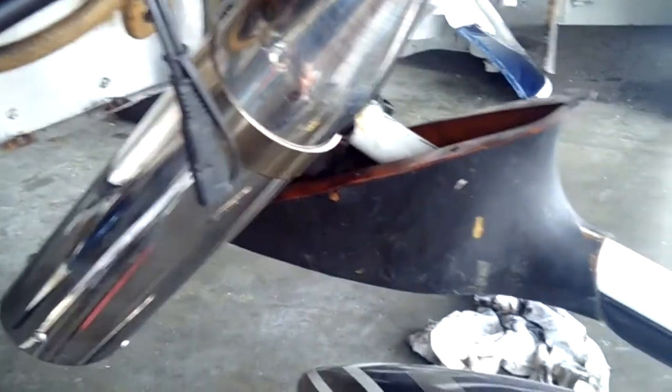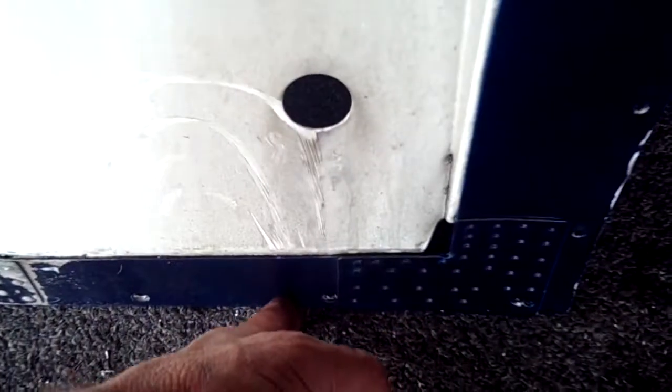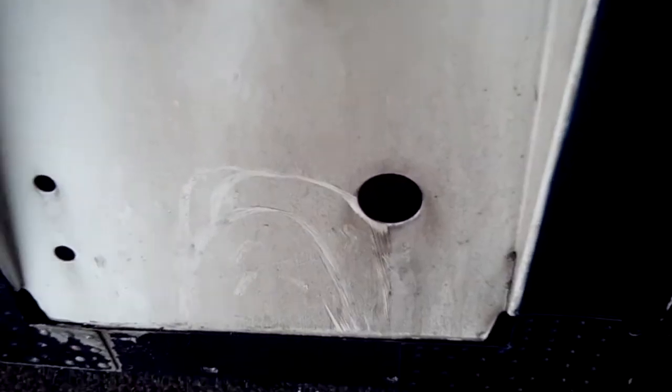We're coming along on the Power Flow installation — the bracket is in place. We drilled it with an industrial 15/64-inch drill bit because we're going through stainless steel, then finished it off with a regular quarter-inch drill. We tapped the pinning plug in and safetied the bolt. The new Power Flow is on the airplane. Now we're down to modifying the cowling: patching the existing exhaust hole on the inside with an aluminum doubler, a fiberglass patch, bondo, sanding, and matching paint. Then we'll cut the lower cowling and put doublers in place so the piece can be unscrewed to remove the cowling without affecting the short stack.